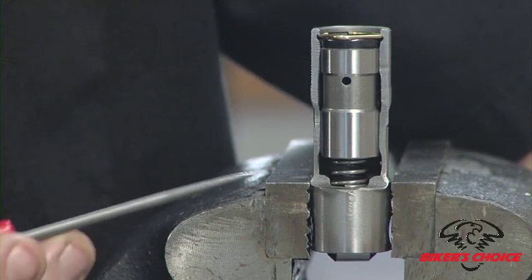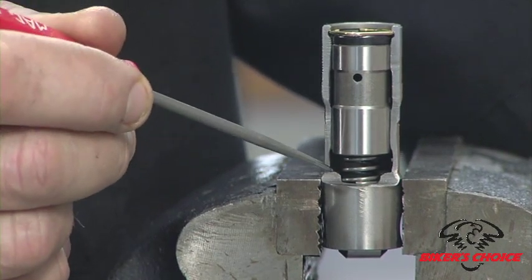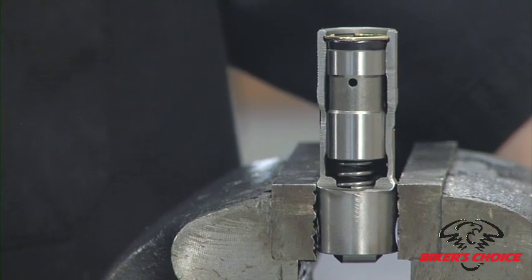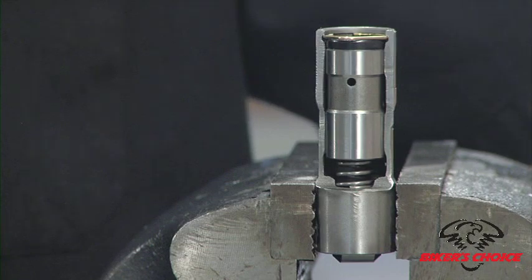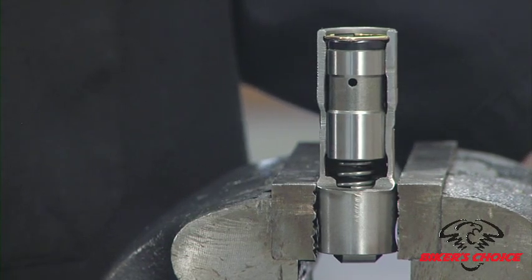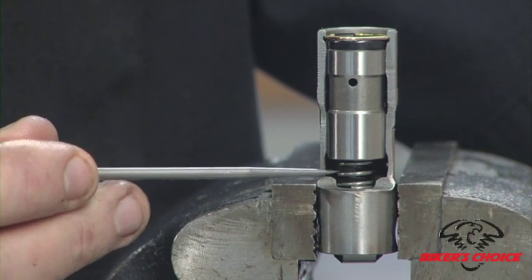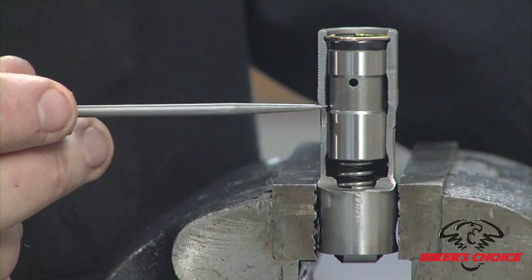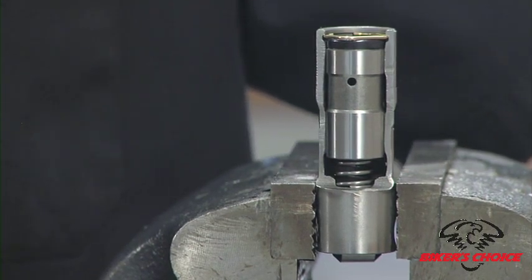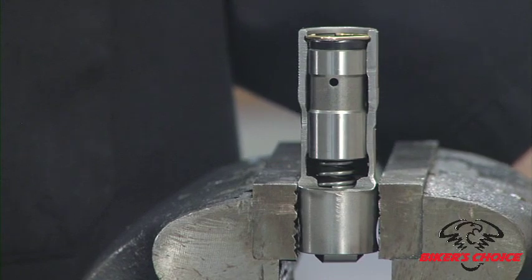What you're doing when you're adjusting the pushrod is closing the gap between the piston and the bottom of the lifter, so the lifter can do its job and compensate for the growth in engine height as things warm up and change distances. For a hydraulic lifter, this travel has to change and take up all the valve lash so your valve train is quiet. The goal is to adjust this piston so it's in the center of that travel. If you measure this with a caliper it's roughly 200 thousandths of an inch, so we want to adjust it down about 100 thousandths.